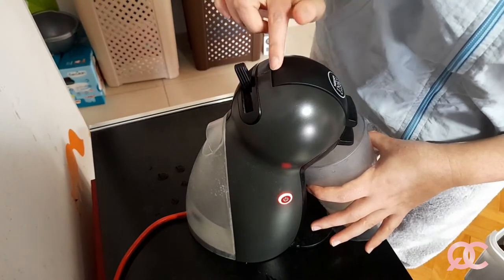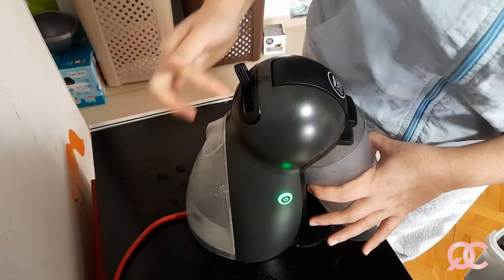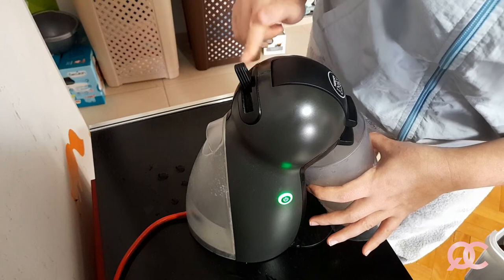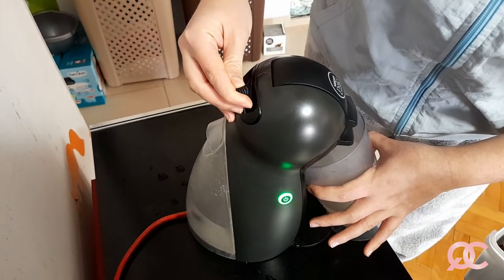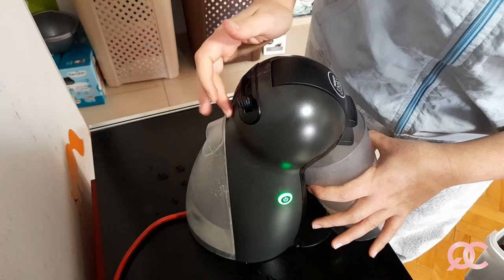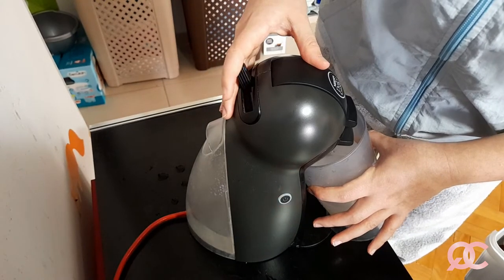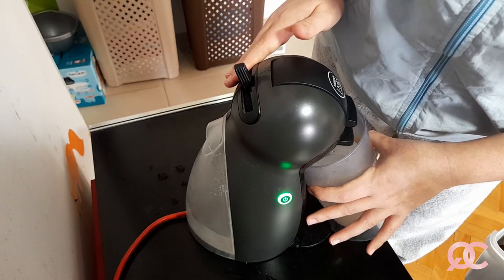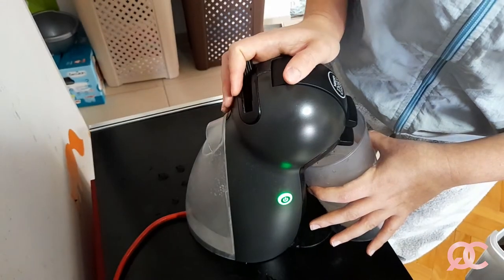What I'm doing now is just making sure that half of the container goes through the hot water side, which is the one that we use most, and then a part of the vinegar travels through the cold water part of the machine, because that one can get stuck. Then I will again stop it and switch it to the cold water part once again, this button is green.